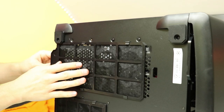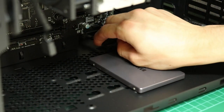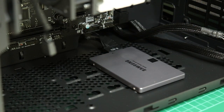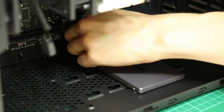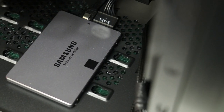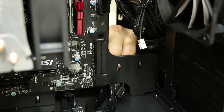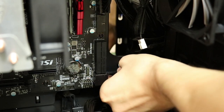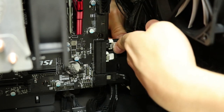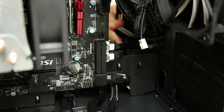Note that the intake capacity will be reduced through the bottom now, and then we can turn the case back over for connecting the power cables and data cables. This is a little awkward since the space is a little restricted on both sides, but with a bit of feeling around, it's not that difficult to connect both cables. Now we can feed all the SATA data cables through to the front compartment and connect them to the motherboard. I always find that installing these connectors leaves one of the ports in an awkward position due to the case's panel, but it comes together well enough despite this.